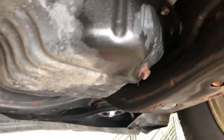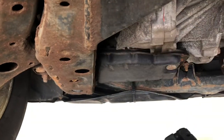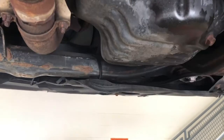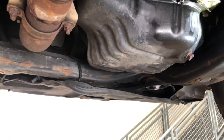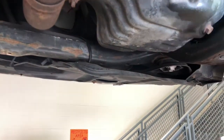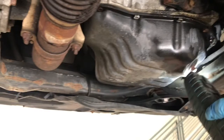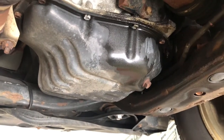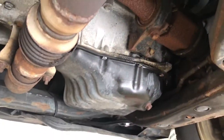You always look to the belt side of the car to find the oil drain plug. You can see we've got a drain pan right here with a plug — that one is for the transmission. If you looked at the vehicle up top, you'd know the belts are on the front side. Even though it looks like the side of the car, this is actually the front side of the engine because it's mounted sideways. The oil pan is always the pan closest to the belts and the crankshaft. So anyway, this is a 14 millimeter. I'm going to drain the oil and then we'll grab an oil filter.